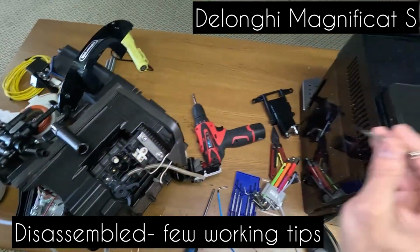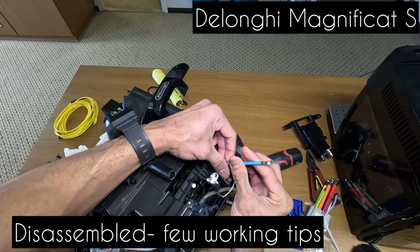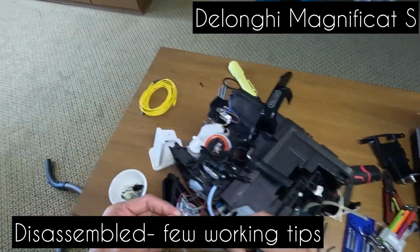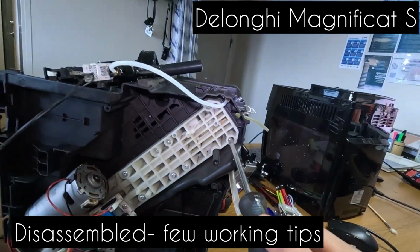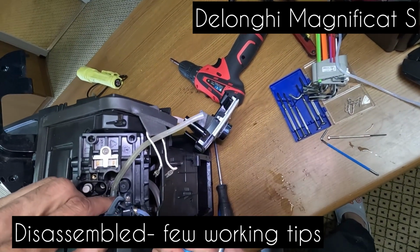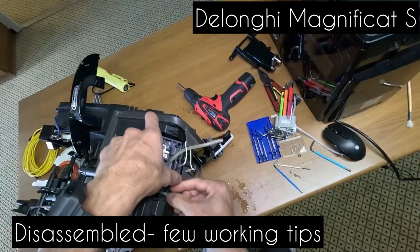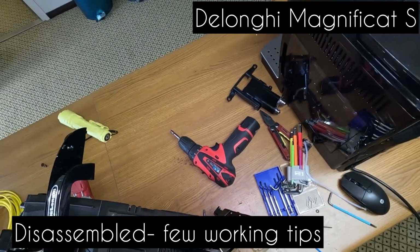I'll show you in the next picture. You can see this one was broken, and I took it off this coffee machine of mine, and put the whole generator set here. So let's take off the generator. Two hex screws right here, and this locking plate, and two screws at this side, one and two. This hose that we took the clip off, be careful, there may be an o-ring that might fall since it's vertically down. All right, the o-ring is right here on the pipe and this hose. Okay, disconnected the hose, disconnected the o-ring. Just keep the hose down so it doesn't come in your path, and now you can carefully pull out.